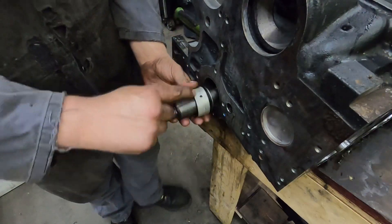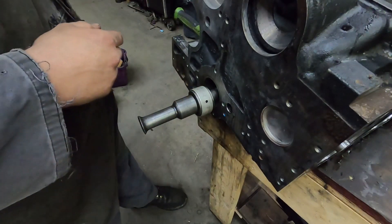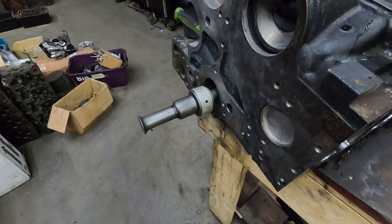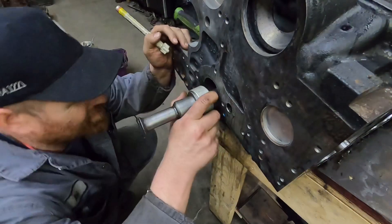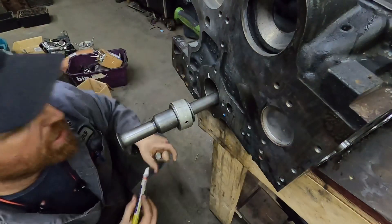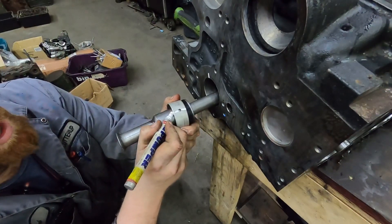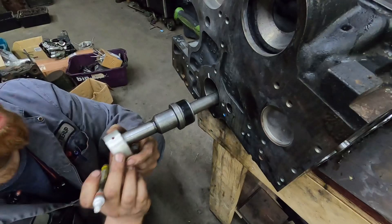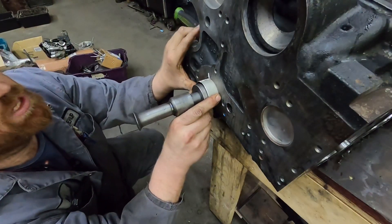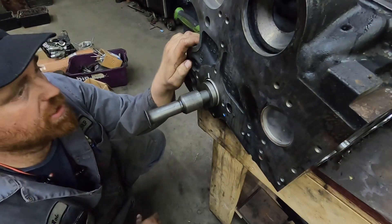The only thing you want to watch is the oil hole — you can see it there — the oil hole has to line up in the block with the oil hole in the bearing. I couldn't find a paint marker to show you guys, but what you want to do is look up inside here and see where the oil hole is. Your oil hole is right here, so you mark where it is, and the oil hole is there on the bearing too. I put a line across it and then a line on the front side like that, so you know where it's going. You put it in and tap it in until it's in the right spot, then verify the oil hole is lined up when you're done.